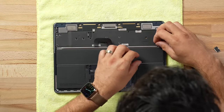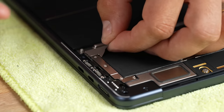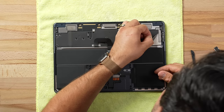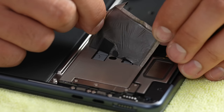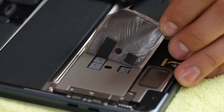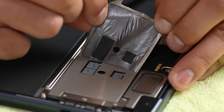I'm pretty sure this material isn't just there to help cool it — because we have this metal casing and we can see the heat transferring from the chip to this metal casing — but probably just to make sure it doesn't melt because this spot is going to get really hot without a fan. Look at that — it is actually changing: we do have a thermal pad of sorts. I'm not going to touch the pad itself; I don't want to mess up whatever coating is there. I'm going to do this very carefully so we don't damage it and can still attach it afterwards. It looks like we have some chips over here, probably some power chips, and the pad actually has another sticker on it similar to what they use to cover this.